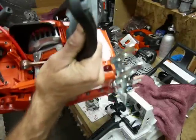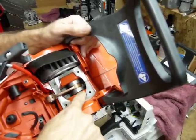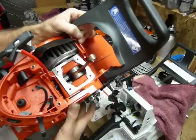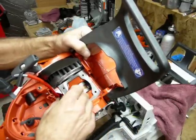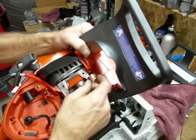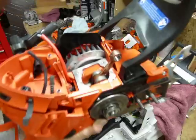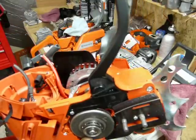The Dolmar air guide directs flow right onto the cylinder — that's how they can get away with the little tiny cylinder head size, which is really sweet if you think about it in concept. Looking at the crankcase itself, there's a pretty small volume right below the transfer ports, which means pressurization starts happening really quickly to push the charge up through, and the pumping ratio is good because there isn't a lot of volume there. A full-circle crank would take up that extra volume — most motorcycles run that, but few chainsaws do. Pretty long rod so dwell time is good. The crank is small though — a small rod journal, small throws, a pretty lightweight crank overall. Metal flywheel — I prefer that because once they're spinning up they have tractor power.